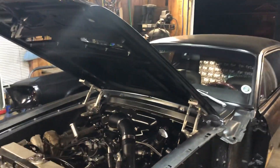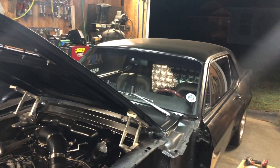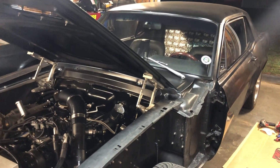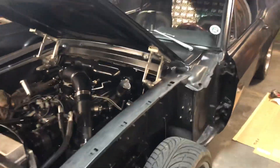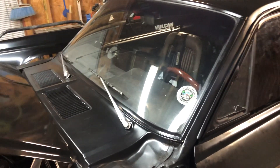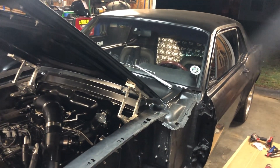For the T56 swap I'll need a new scatter shield, flywheel, and clutch — I want to put a twin disc in. I'll also have to change out the clutch slave cylinder to a slip-on style. The transmission conversion is a chunk of change, and I may have to raise the tunnel — I've heard mixed opinions on that. If I do raise the tunnel, I'll probably do the roll cage at the same time since I'll already have the seats and carpet out.